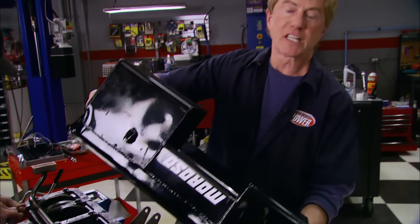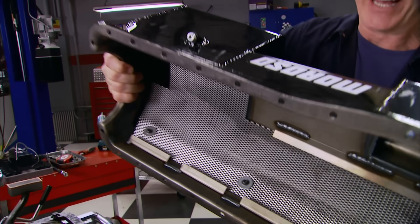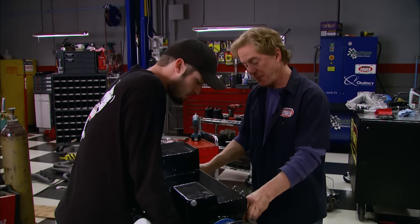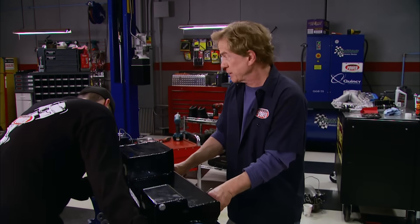With the supplied gasket, studs, and shaft, installation is that easy. We'll finish the bottom end with this upgraded 7-quart capacity Moroso pan with trap door baffling and a scraper to help the crank spin freely. Next time we're going to show you how to measure for the push rods, finish the build, and bring this thing up from 389 to well over 500 horsepower.